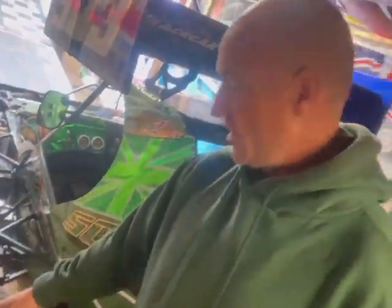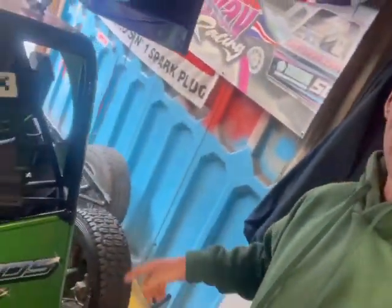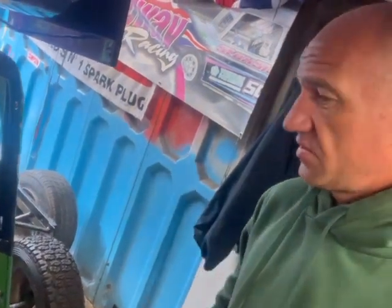Just for setup purposes, we've got a shale tyre on the outside, and then what we were thinking of doing is putting a Yorkie on, because you've got to run three of those Yorkies on the inside, and that gives it the same two inch stagger. But what I might do, because I managed to source some of these tyres which I couldn't get before, is leave this tyre on if I don't get any more in time for the weekend, and then put that Yorkie on that's there, put that back on as a start point.